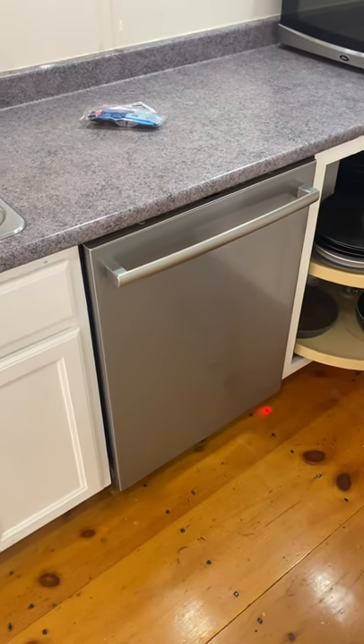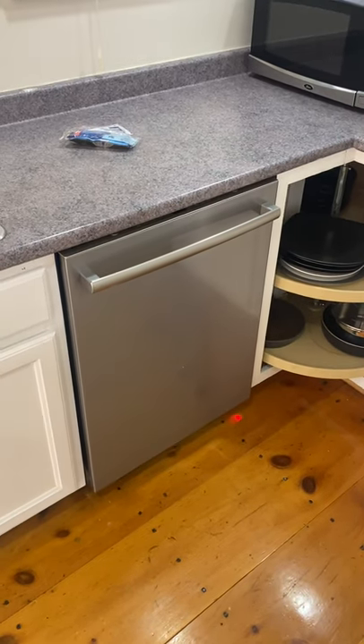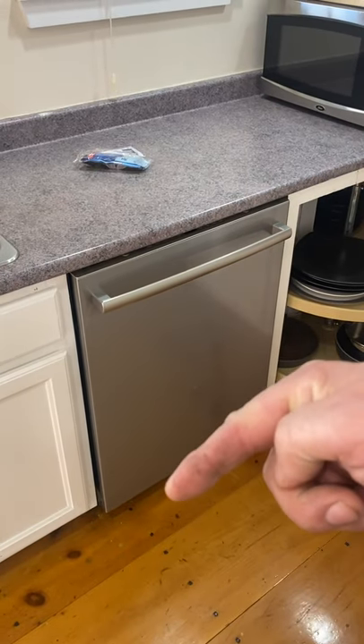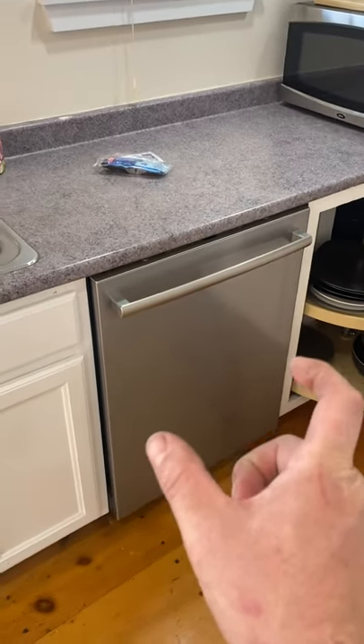Another perfect install with a Bosch dishwasher — their quality — and you got a nice little laser beam on the ground. For you plumbers that don't use a level: dishwashers have to be level this way, they have to be level this way, and they have to be centered perfectly this way. When you look up here, everything should be absolutely perfect — perfect spaces everywhere.